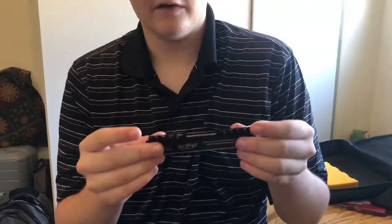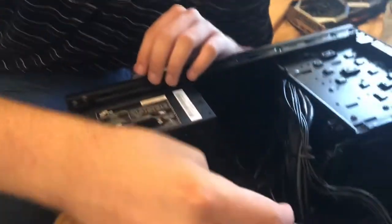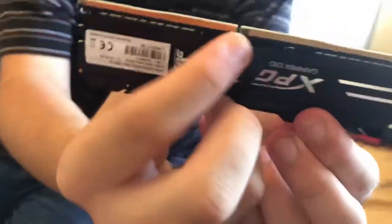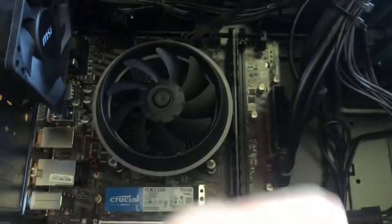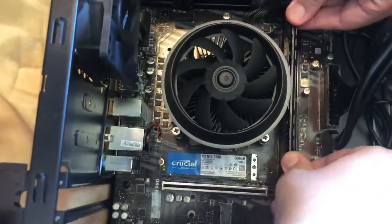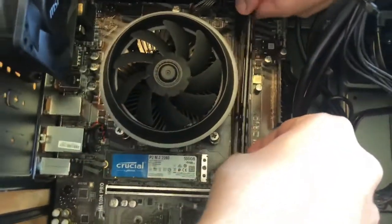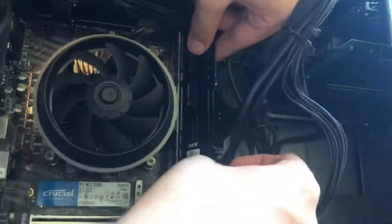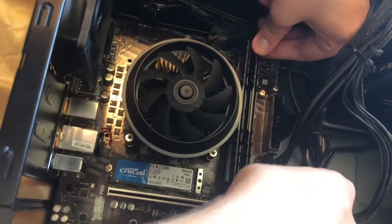Here is the RAM — this is the part of the PC that you can upgrade over time. Right now it just has 16 gigabytes total with these two sticks. To insert it, you gotta watch which half goes in where — the longer half goes on the longer half side. There's a notch right there. You just line it up and push it in. There's one in, and then you just do the same for the second RAM stick. Short side on the short side.